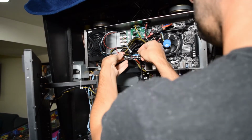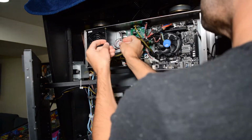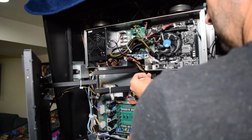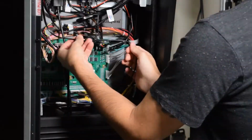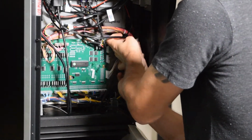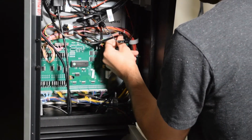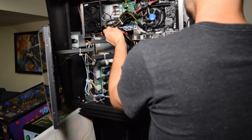Using the included zip ties, clean up the cables in the box. The wires will feed out the hole in the bottom center of the metal box. Make sure to leave a little slack in case you need to adjust something in the future. Next, route the PinWoofer wiring harness cables through the existing wire looms, again making sure to leave some slack. Now go back and clip any excess off the zip ties at this time.